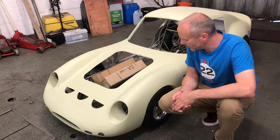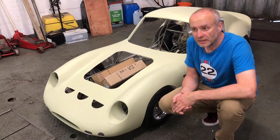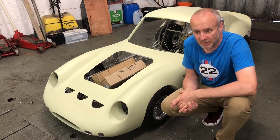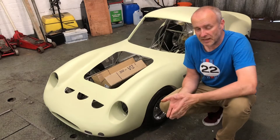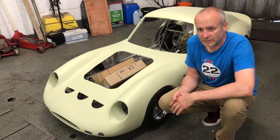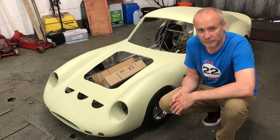So that was why I started looking around. The first engine I saw was one by Martin Orndorff — that was for sale on eBay. He makes lots of V12 engine kit parts and plans and a lot of other model engines, but they're air-cooled. So I was thinking about how I could make it water-cooled, and then I thought, actually, it's quite a lot of work — maybe I should just make my own. That's when I started looking at the Honda GX25 for parts.